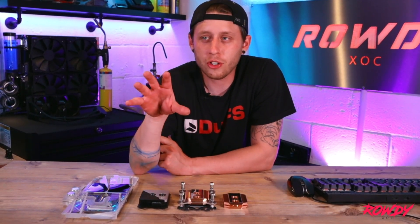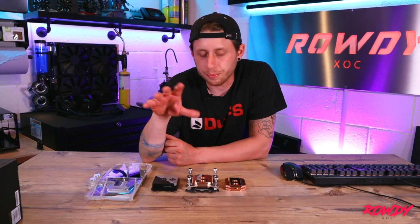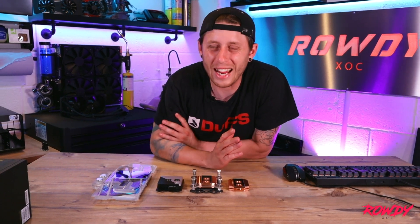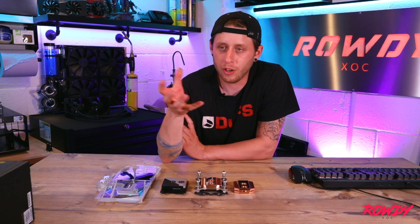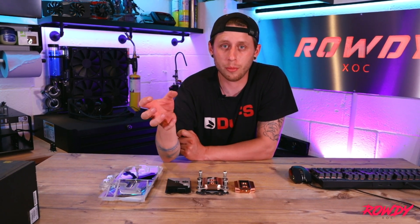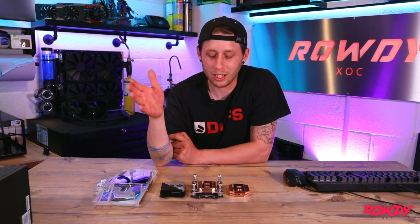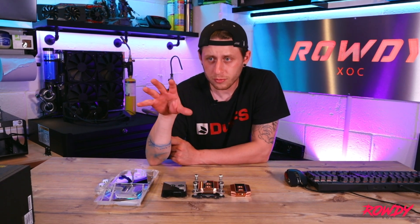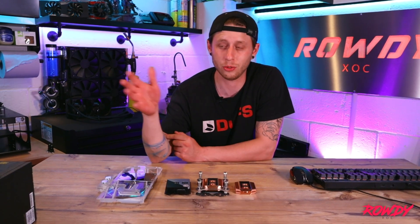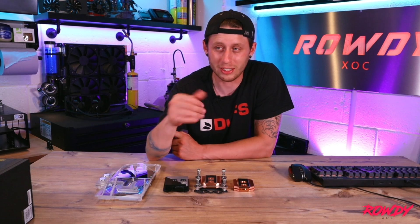The next thing you'll see is different terminology — nickel, full nickel, and acetal and stuff like that. You don't need to pay too much attention to that at the beginning, not for your first loop unless you've got a whole load of money to go wild. Full nickel would be a solid nickel water block — like this one here. Acetal is basically plastic; it'll have a plastic top with a metal cold plate, and you can get different materials on the cold plate — copper, nickel, various metals — though the most common is nickel these days. In my opinion, for basic ambient watercooling there's not a great deal in it. I've used acetal blocks and full nickel and not really seen a benefit just by having one or the other.